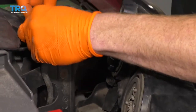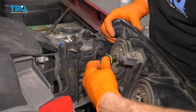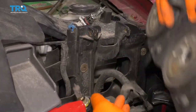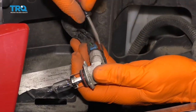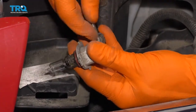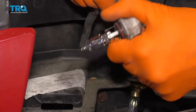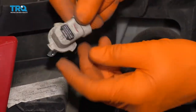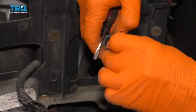We're going to carefully set this aside. Do the same right here — twist that out for the headlight bulb. Take a look and make sure it's in good condition. These look great, and there's our headlamp assembly. Next, we're going to take the bulbs off of here. Just take a small pocket screwdriver, weasel it inside there, separate those prongs, and then draw the bulb off. This one's the high beam, and this one would be the low beam.